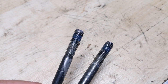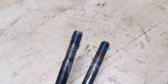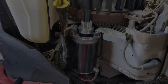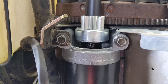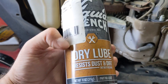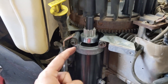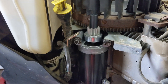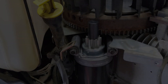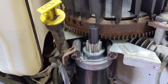I'm going to go ahead and get this third gen starter installed. When I install starter bolts, I do like to use a small dab of blue thread locker just to prevent starter bolts from vibrating out. The third gen starter is installed, but you guys can see I've lifted up the gear — don't worry, it's not stuck. I'm just going to be using a little bit of Liquid Wrench dry lube on the shaft to lubricate those grooves and allow the starter gear to go up and down smoothly. With the parking brake on and the engine throttled down, I'll go ahead and turn the key over and engage this new starter.